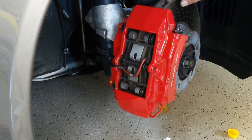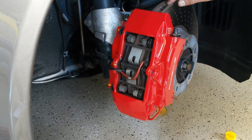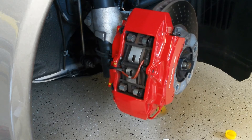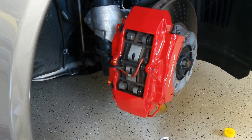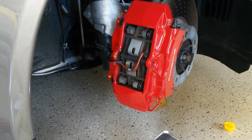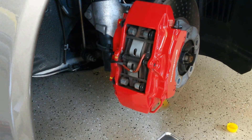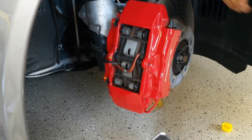I'm already done with the rear wheels and now I'm doing the front wheel. The order in which you bleed is very important — you want to start at the wheel which is furthest from the master cylinder. Since the master cylinder is on the front driver's side, the order is: first the rear passenger side wheel, next the rear driver's side wheel, third the front passenger side wheel, and lastly the front driver's side wheel. The process is exactly the same on all four wheels.